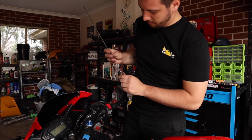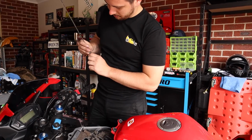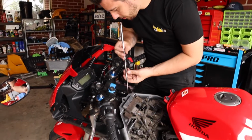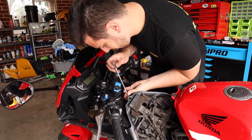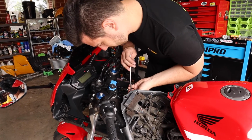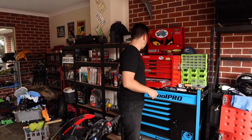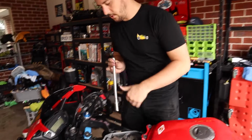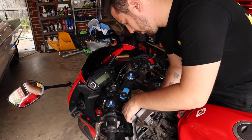And we're going to try that again. I've been lucky before, I might not be lucky this time. We'll see. Perfect. Okay, spark plug has just caught a thread using the magnet, so I can get that off, and then what I'll do is I'll lower this socket down gently, and then I will slowly turn the spark plug by hand until I can feel that it's going in.